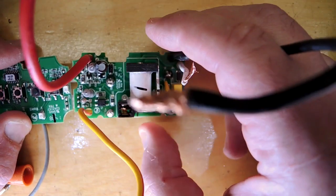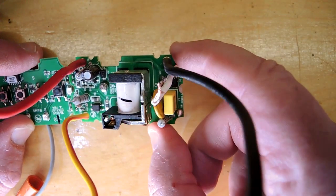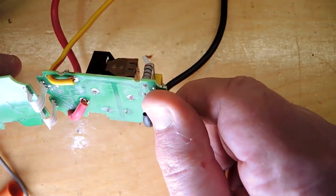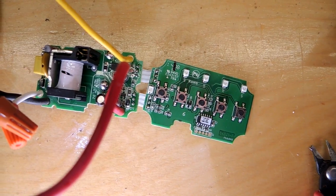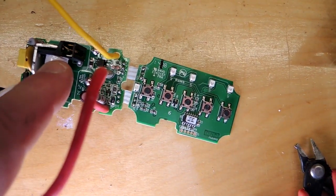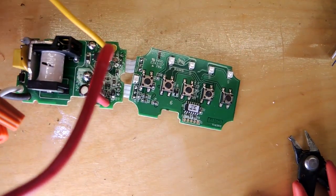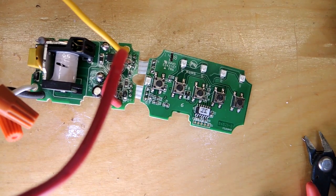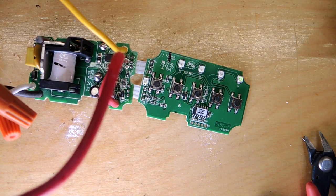Let's see if that's true — let's reconnect the power and see if this relay starts to vibrate, which would imply that a capacitor maybe is drying out or something on these assemblies. I've just connected it to a power supply lead. Here's the relay, here's the switch with the microprocessor. I'm just going to re-energize the product and see if we can see what's causing the noise — I suspect it is the relay.